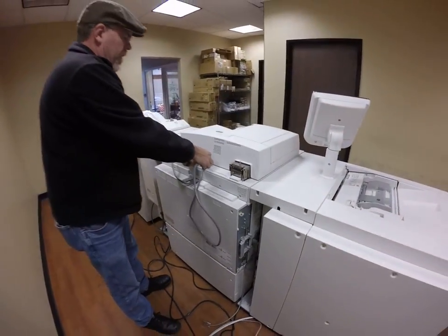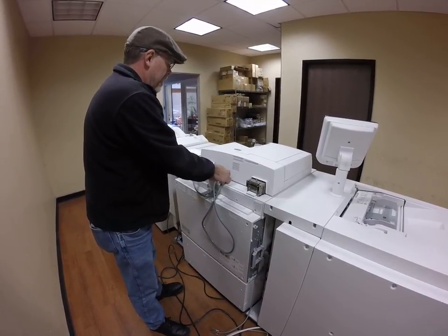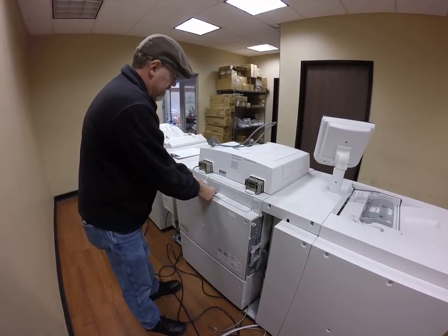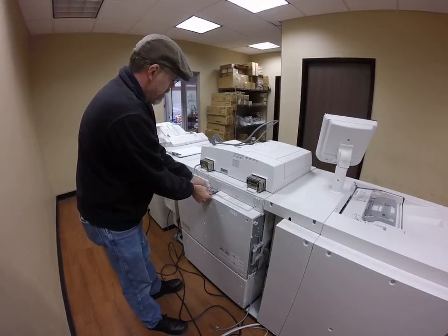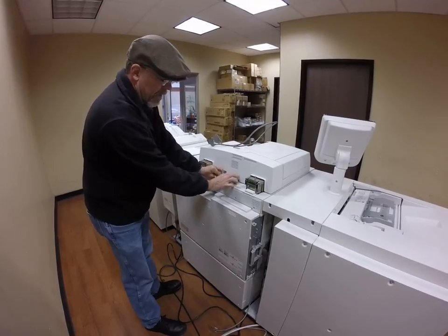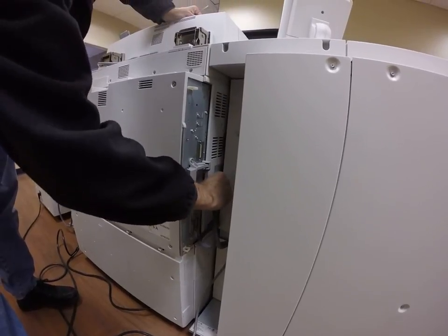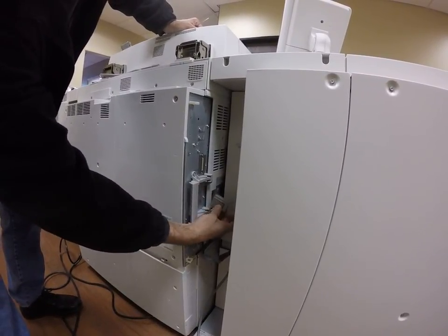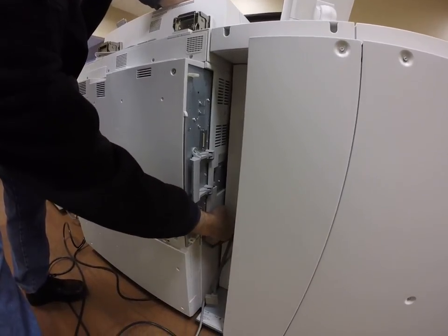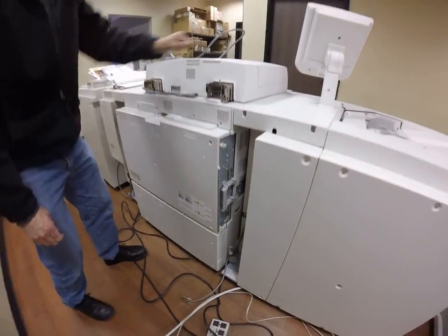You'll also want to take it off the back of the scanner. You don't want to leave any cables hooked up — it can cause damage to the cable and the connector during shipping. The last two cables we need to disconnect are for the feeder. There's one here; you just depress in on this connector and that releases it. And there's another one here — there's a depression, you press it down and pull, just like that. And that's off.